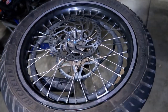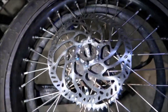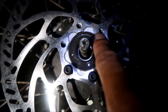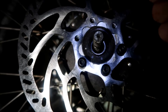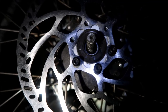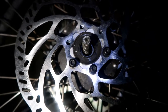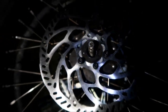Alright guys, it's a one-star review. So I tried to grind the holes round with the Dremel tool. It turns out the holes drilled in this rotor aren't even the right pattern — it's off. I can get three of the bolts in there, but if you look at the messed up holes, it's still off. I actually grinded it the wrong way. The hole is oval shaped — not round. So yeah, I'm not going to install this rotor.